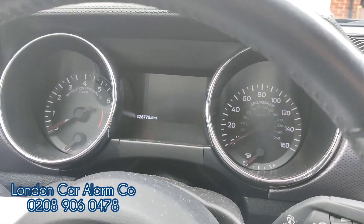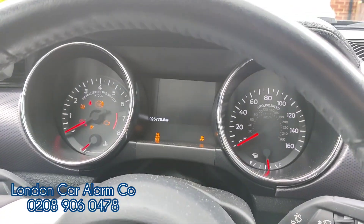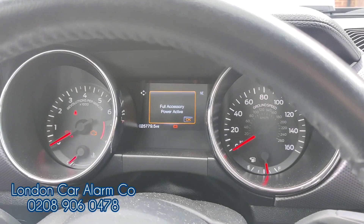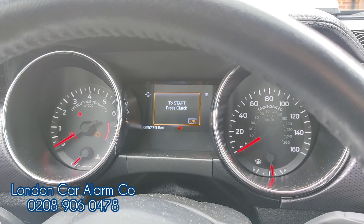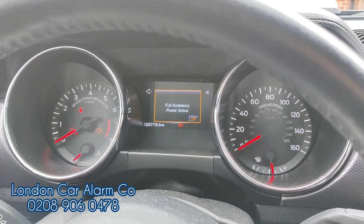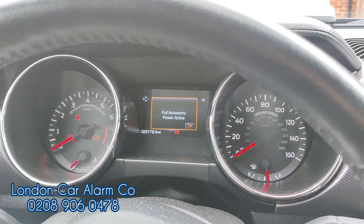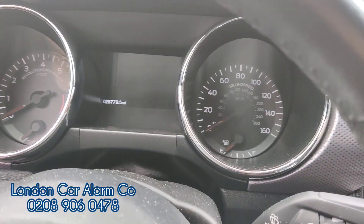When you want to put it back into protected mode, start button on, just reverse it — tap tap tap tap tap — no flash because it's still in valet mode, it's quite covert. Keep watching carefully and we'll get confirmation by the indicator flash. There you go, now out of valet mode.